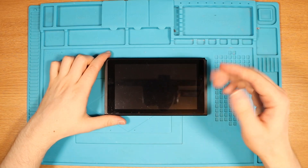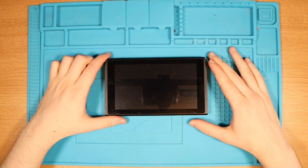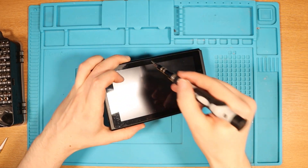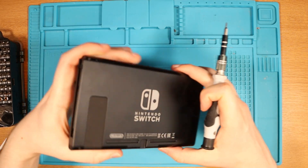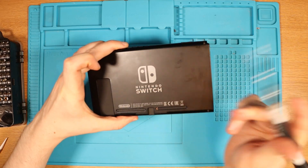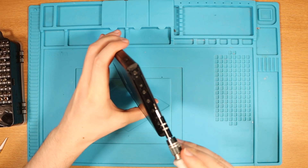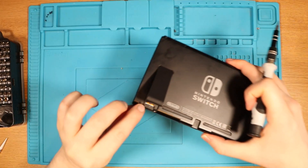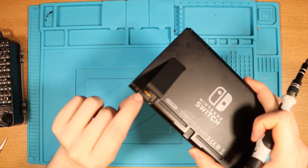With the information we have, I'm now going to take it apart and have a look at what's going on. I'll be using a triple zero Phillips screwdriver for the two screws at the bottom and the one on top, then a tri-wing 2.0 for the four on the back, and probably a triple zero as well for the ones on the side. There's also one under the latch which is a Phillips triple zero.